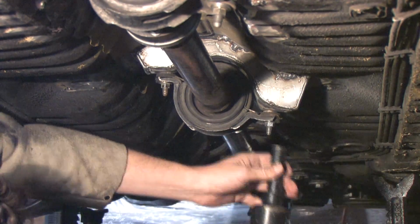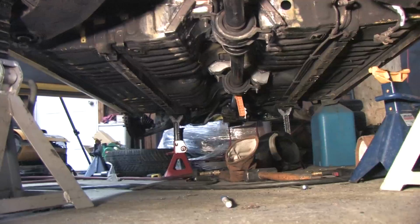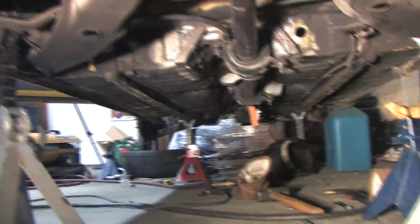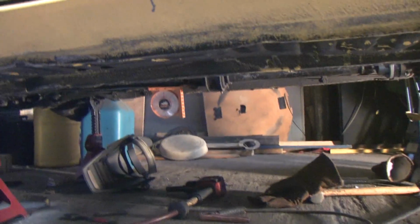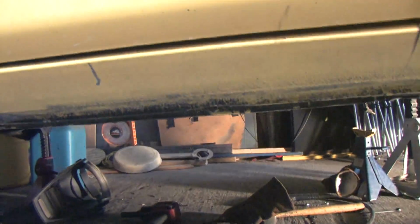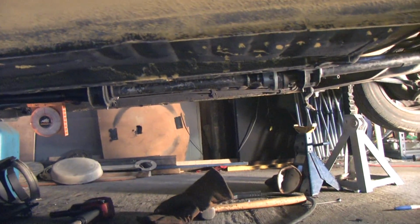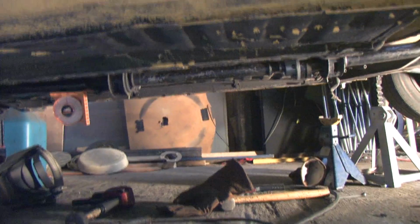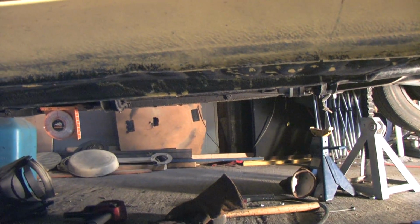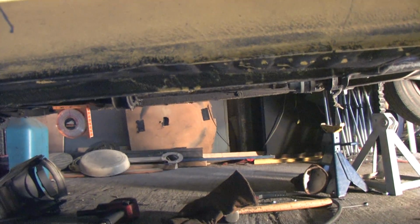There you go. Now there's a factory fit all-wheel drive Colt hatchback. All the wheels work. I mounted the center shaft parallel to the frame of the car and added about 1.5 degrees of righty-lefty in between to make room for exhaust work, and so that the angles I put in on one side came back out evenly on the other side. The result underneath I'm thrilled about. The carrier bearings only protrude about 1/2 inch below the frame rails at their lowest points. Plenty of ground clearance. The exhaust will hang lower than that. It's very nicely tucked in there.